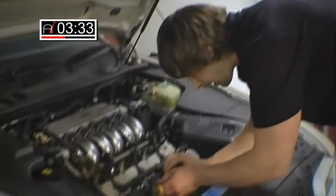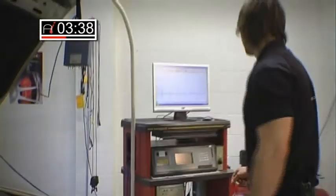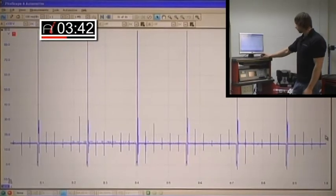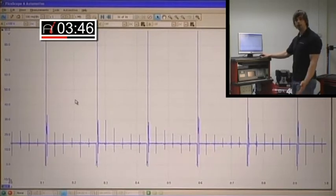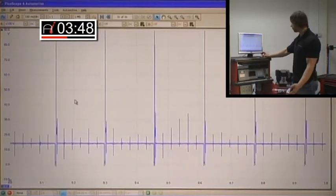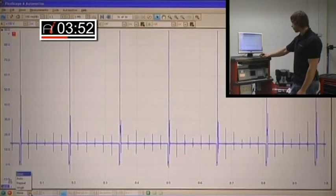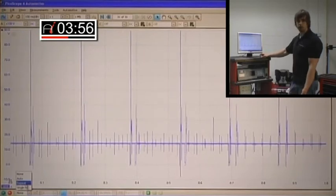So I've got my final wire left. Now you can see I've got a mixed array of signals, which tells me it's a trigger line. How do we clean it up and get just one event repeating itself? The first thing I'm going to do is put a repeat trigger on — I've got three different triggers I can use.